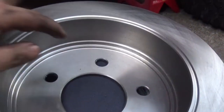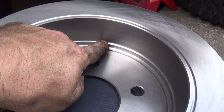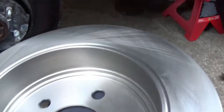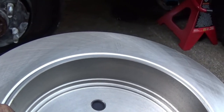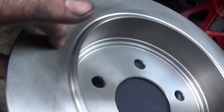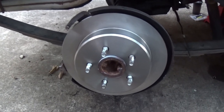So it's a little bit heavy but hey, it's gonna work. Slide the rotor on. Now before you slide your rotors on, if you get brand new ones like I did, get inside here with your brake cleaner and a good rag and clean up the brake surface. Do this side as well, because they put protective oils on there, and oils and brake pads don't mix — whenever you go to hit your brakes, you want them to grab. So brake cleaner, a good rag, clean the inside and both sides of your brake surface. And there it is looking all shiny and pretty.